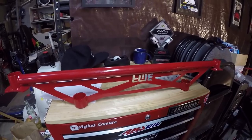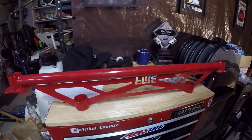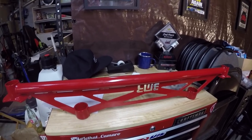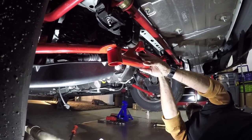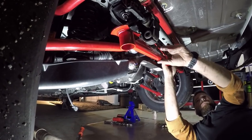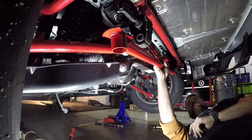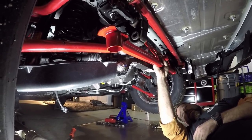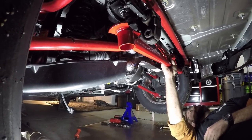The install is not too difficult, so let's get right into it. This is one of the rear cradle mounts — the rear side of the rear cradle. They also have the front side mounts, but I don't have those yet. It's just four bolts, shouldn't be too difficult. You'll see the two small stock cradle pieces don't span the whole car, but this one does — it connects both sides together making it stiffer and hopefully helping with wheel hop.